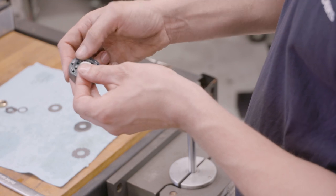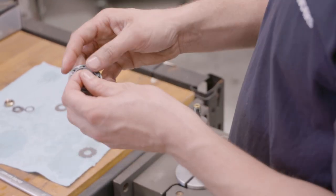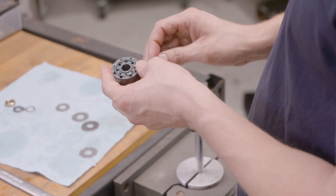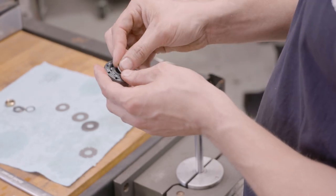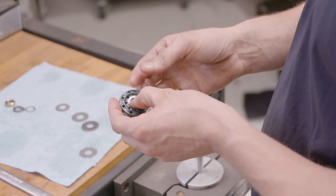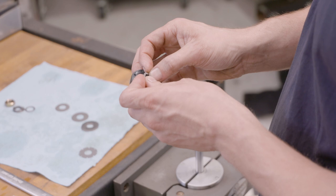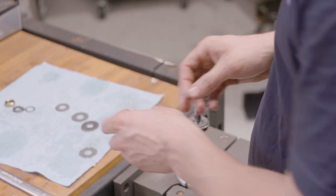Because we have a 0.5mm hub-to-seat height difference, we have different shims of different thicknesses to change how much preload we can run. Our spacer discs range from 0.4mm thick down to 0.15mm thick. However, the 0.15mm thick disc isn't as durable, so we only use these in extreme motorsport cases. For most road cars we use 0.2mm at an absolute maximum.